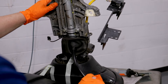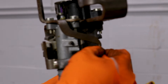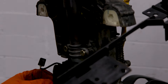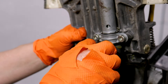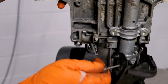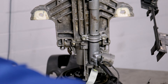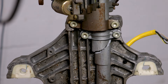There it is — there's the bracket. This is where the shifter indicator cable hooks onto, and this is where the shifter cable hooks onto. Right inside here there's a spring — I'm going to show you all of it. What I'm going to do next is push on that little tab right there, and over here it's just pried on a dimple that Ford supplies. I've got a T30 and I'm going to loosen this up and take that one out.